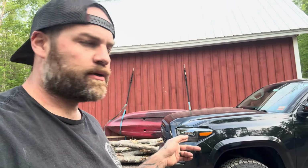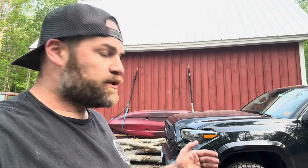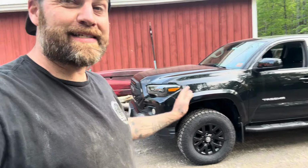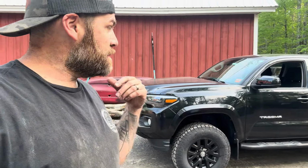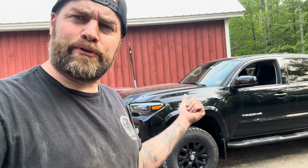I believe I said it early on, 2-inch. Where we took the whole struts out and put the spacers on the top, took you through that process, and then a set of Toyo 265/70R16 tires. Take your stock Tacoma and make it look more like a truck. Pretty badass, I must say.